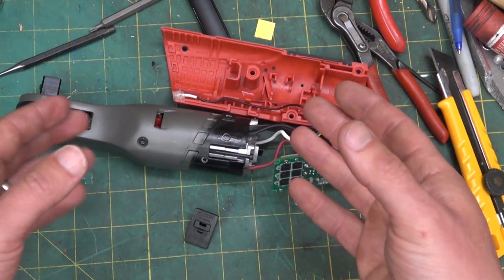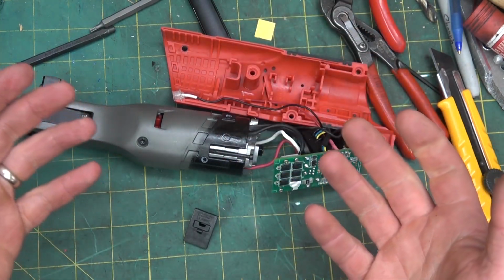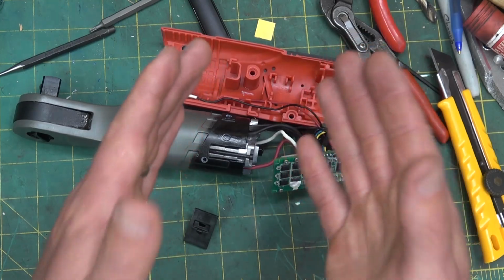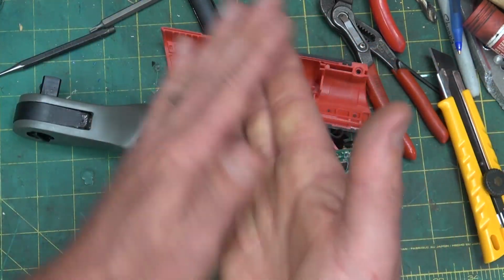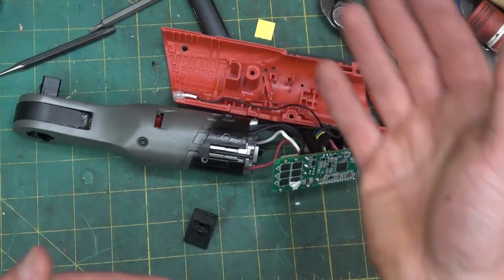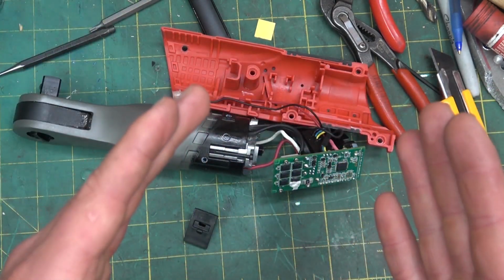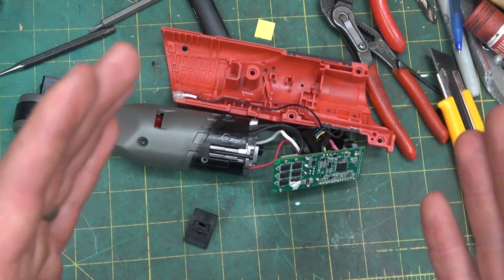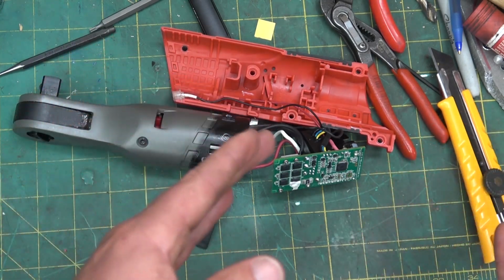I've been getting comments like, when are they going to start using brushless DC motors in plug-in appliances? And to my mind, that's utterly ridiculous, because you're adding another component. Are you really saving that much energy? The energy density out of the wall, do you need more than a horsepower? And there's heat and all that stuff. But essentially, if you have a plug-in device, you want the old school dumb brushed motor, because you're not so worried about those kinds of losses.